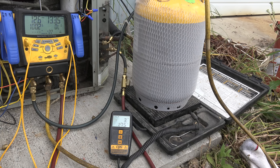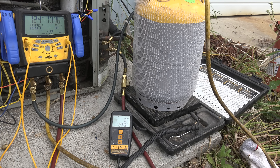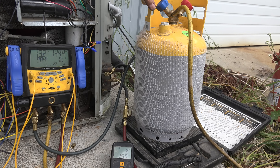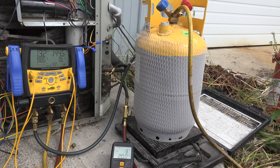I was blocking the condenser a little bit. I've pushed just about 75% of the refrigerant out of this thing. Now I'm going to put the refrigerant back in as a gas — that should leave behind any oil that was pulled out with the liquid refrigerant. I'm going to take from the vapor side and recharge this back into the unit. When it's done pulling all the refrigerant out of here, the only thing left should be a little gaseous refrigerant and oil. Let's see what happens.